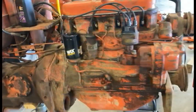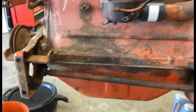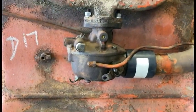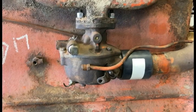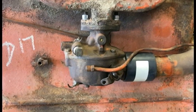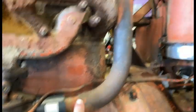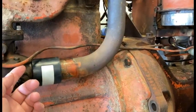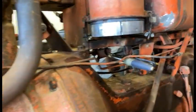I made up some connections on the carburetor. I actually took the carburetor off, separated the two halves, and cleaned it out good with carb cleaner — and I'm glad I did, because there was a little bit of gunk built up on the inside in the bowl section and there was also some rust. I cleaned everything up and made sure I didn't get anything into the jet section. I've got a couple of new hoses and some hose clamps coming, and the fuel line, which was plugged on both ends, has been cleaned out and is ready to go in.